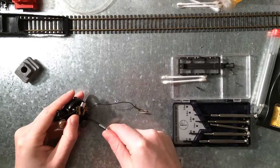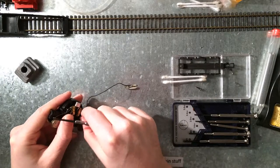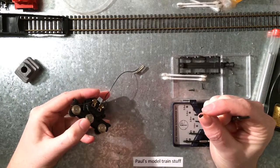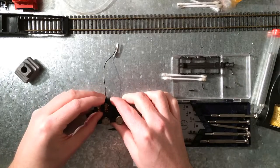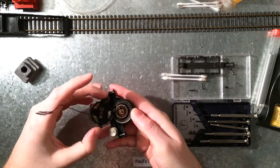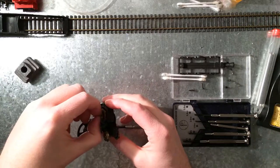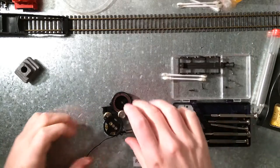Let's take the plate off. Before I do that, I am just going to lift this and get the remaining spring and brush out. And that brush is actually okay. Now, to get the cover off — the front plate — and it reveals a very, very dirty motor and the missing other brush. Just get this out. And again, putting this into my favorite solution, the IPA.